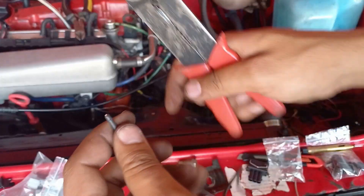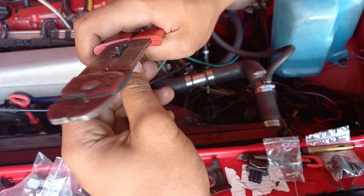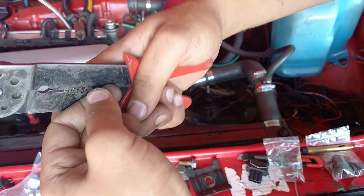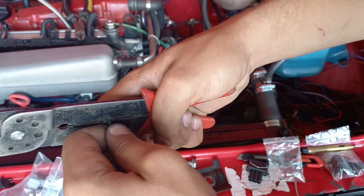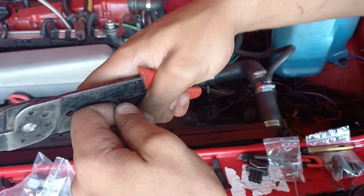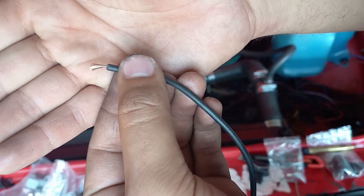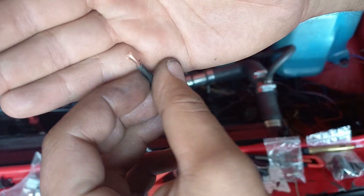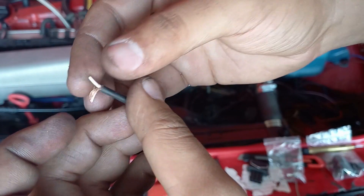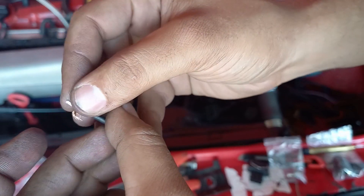When initially wiring up the car I was concerned about where I would get good wire to run to my crank for a good crank signal. I thought I had to order something online and wait many months, but I found a better solution — this wire I'm stripping right now was used on a guitar. You need shielded wiring for your crank or cam signal as well as your speed sensor. This wire has a copper wrap around it to protect it from magnetic inductance, and in the center it has an insulated signal wire.